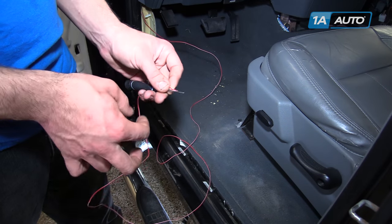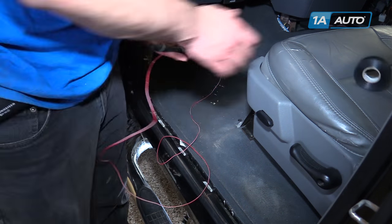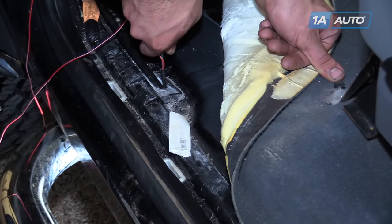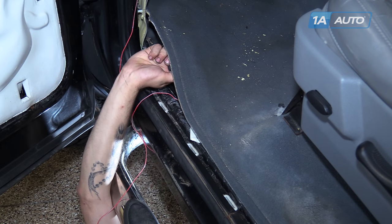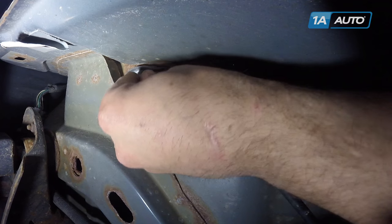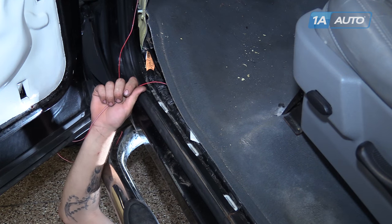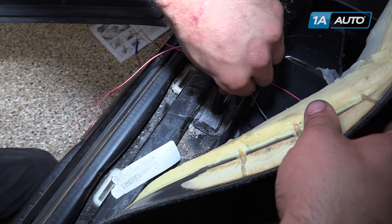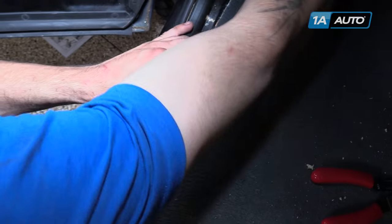We're gonna take our wire, tape it to a sharp straight pick. Don't want to make it too thick, but we want to make sure it's on there good and tight. I'm gonna peel back the carpet a little bit, just to the outside of our e-brake cable. Send the wire down through the rubber boot. Move the pick from the rubber while holding the wire. Now we can pull our wire through. Make sure to leave enough slack that we can tuck it back under the carpet. That crimp connector won't fit through, so we'll just lay it all back down under the carpet.